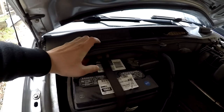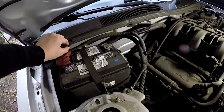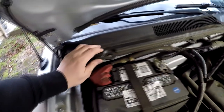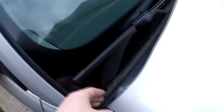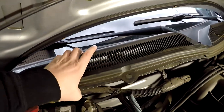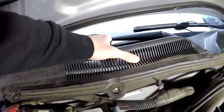What we need to do is take out these plastic rivets — not sure what to call them — there's one here, one here, and it looks like it divides into two. It is broad daylight out but with the position of the car you can't see very well, so with the help of an LED light we'll move forward. Once you take those rivets out, go back and gently with your fingers pull up — there are two clips in the way. There are four of them total, just gently pull them up by hand and separate the piece and take it out.